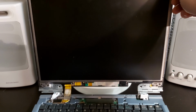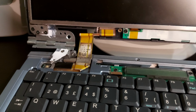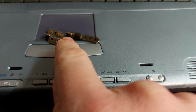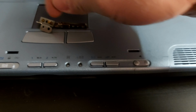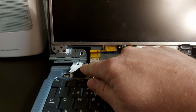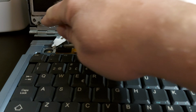It's kind of janky, but it does actually work. So in short, I took the original hinges and I figured out the length between the holes. I held it together, measured the distances between the holes and the holes that are supposed to then go here, and the holes that go here and also in here. And then I drilled the corresponding holes from the original hinge into here.